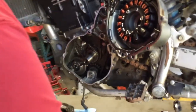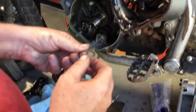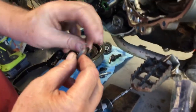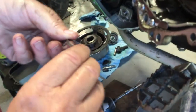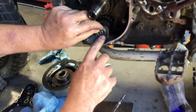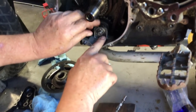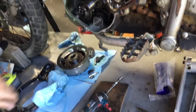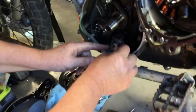Okay, so all of those are in place. So the next thing we do, we put our torsion spring in there. And this is the proper bend. It's bent like that on purpose. And this wants to be straight or in just a little bit towards the center. And so now we put it in the hole. Sometimes I have to use pliers to help me get it in there. Today we got lucky. And now we put the doohickey on the shaft.